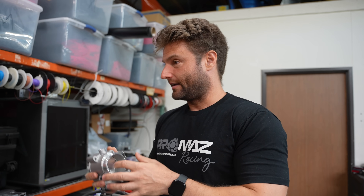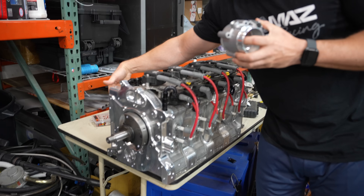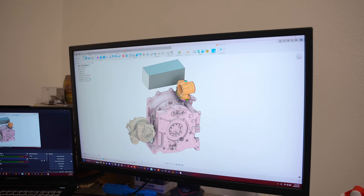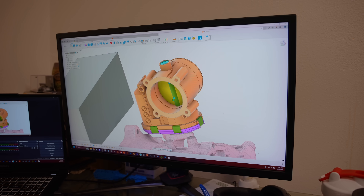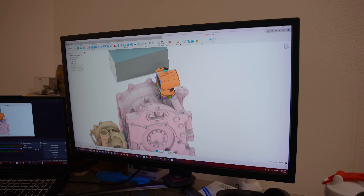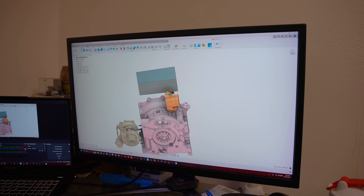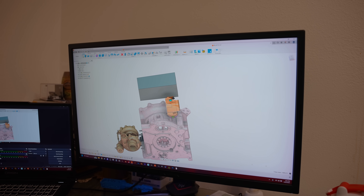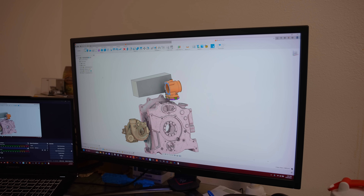Let me show you what he's done, and then I just have to print it. There are some small modifications we need to do, but we need to get this all the way down to the ports on the one rotor. I scanned the turbo, scanned the engine, placed them where they are. Bosch has the throttle body — it gave us the exact dimensions and flange. I told him we're more than likely going to have a water-to-air intercooler back here so the turbo can come up over, cool off, and then go into the throttle without covering the engine.